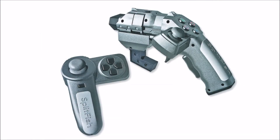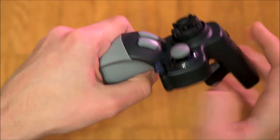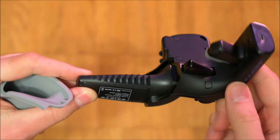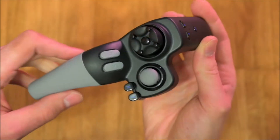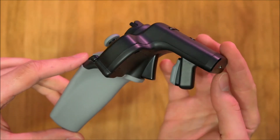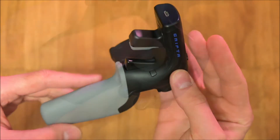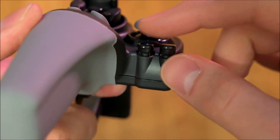Visually, the controller reminds me a lot of the Splitfish Dual FX prototype, which was an LCD-compatible light gun. The silicone-made grip piece feels very sleek and is modular, offered in various sizes with an additional form-your-own grip option. Underneath is the battery compartment which still refers to the once-planned but never-released Bluetooth functionality. The rubber dome B and A buttons, the convex joystick head, and the modular cushion of the push shoulder button are made of the same comfortable material as the grip. At the bottom of the analog clickable joystick are independently mapped rubber dome versions of X and Y, which protrude at different depths to maximize ergonomics.